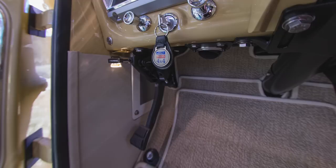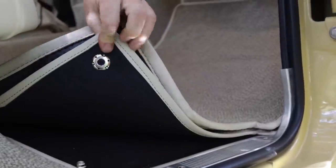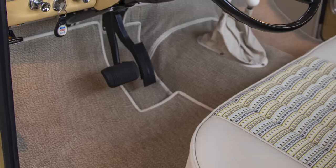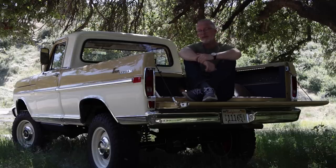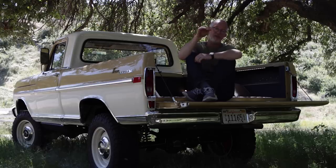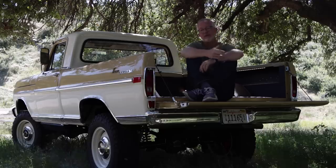The carpet has removable mats — the entire carpet system is using vintage Rolls-Royce hidden one-sided snaps for serviceability. So if you need to get to harness trunks or something run under the carpet, you can get to it down the road. That also allows us to run multiple layers of sound-deadening products: Extreme Liner, Dynamat quilting, and some aerospace shields. There's also a heat shield between the sheet metal trans tunnel and the transmission, which helps bring down drivetrain noise and radiant heat.